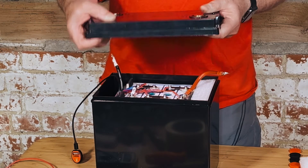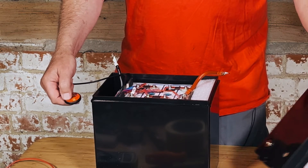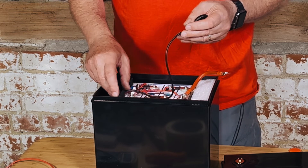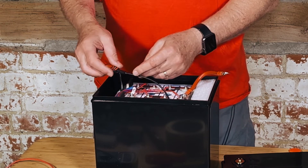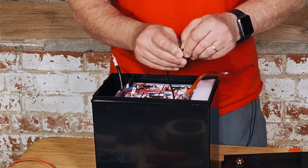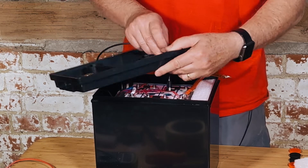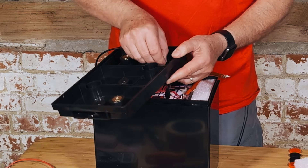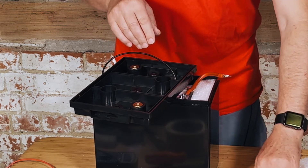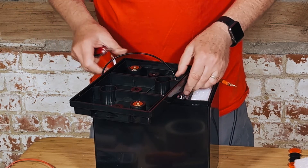We've drilled a hole for the Bluetooth dongle and are placing it externally. Some people leave it inside the case, but it has a wake-up switch — the Bluetooth goes to sleep if not used for a length of time to save power and prevent draining the battery. We thread it through the grommet first. Getting the grommet in is usually one of the most difficult parts. One of the best tools is an old Swiss Army knife blade with a screwdriver blade — quite blunt so it doesn't cut into the grommet.